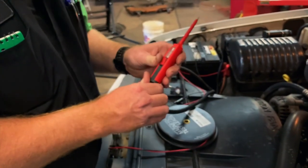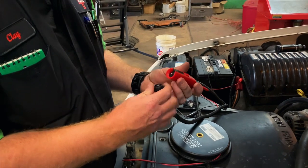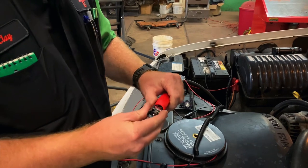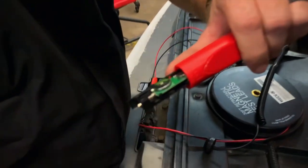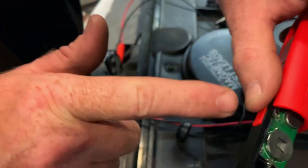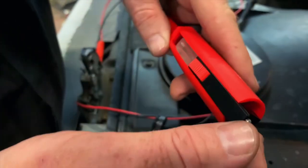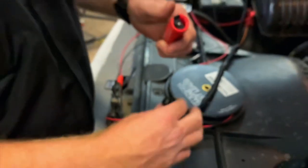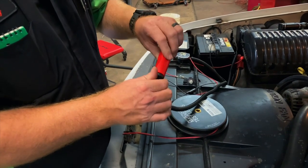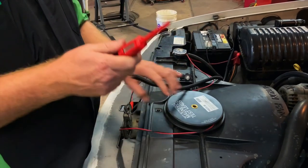When you get it, the battery's not installed, so you have to unscrew it. When it comes out, you have to push down on the switch to slide the whole unit out, and the battery slides in here. If you don't press the switch in here, this thing ain't coming out of there. You've got to watch because your little bulb and fuse is there, so just snap it back down in there and screw that back on. That's why I'll make a video like this so you guys won't destroy your brand new test light.